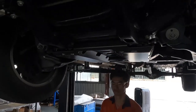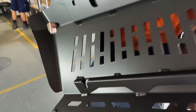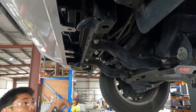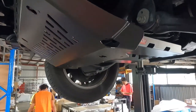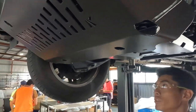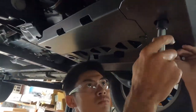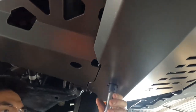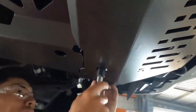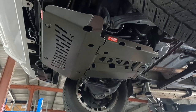Next, the front guard. Put two M8 bolts up on the frontmost holes, just a few threads to hold them. There are a couple of slots in the front guard to make installation easier — you should be able to slide it on and it holds itself up while you grab the other two bolts towards the back. You'll need a 12mm socket. Once it goes up, align it with the sump — you can see it fits beautifully, tucks up and hooks over nicely with really nice gaps.